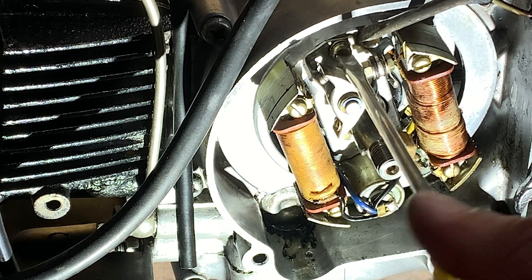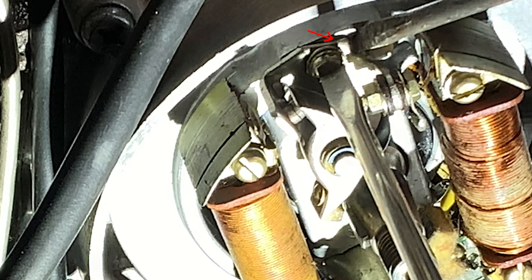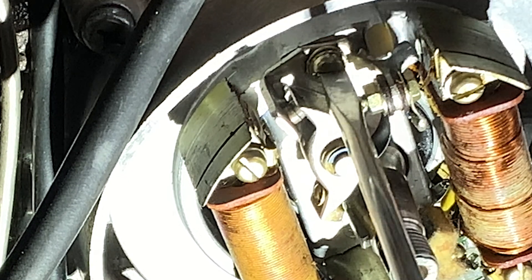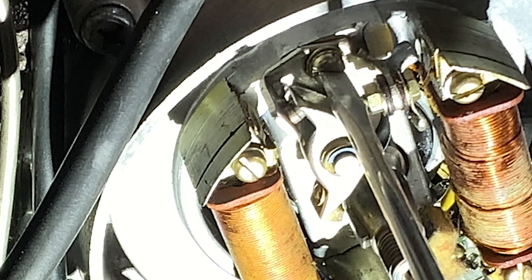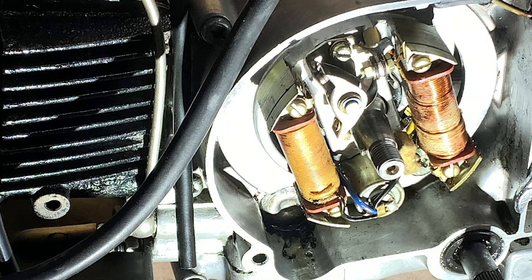Because it's advanced, I want to loosen the locking screw and pivot the contact breaker unit slightly to the right. If you've got it close using a feeler gauge, it might be easier to take the flywheel off and just nudge it a little — not even a nudge, just loosen the screw. Look at it while thinking about what you want it to do. That's how small these movements are.